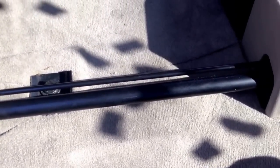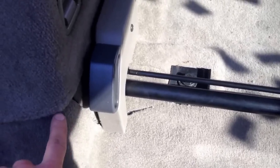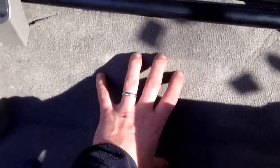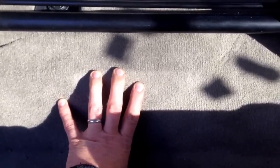What I did was make a cut in my carpet, since the third row seats are usually down and I don't use them often. I cut along here, along here, and along here, then cut in the middle. Once you put the carpet back it's not that visible. You can roll the carpet back and gain access to the fuel pump access door right over here. For the other half, you open the access door on the driver's side — I again cut the carpet along here, along here, and along here.